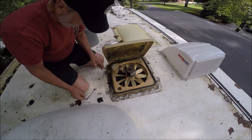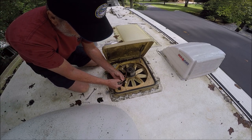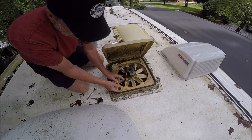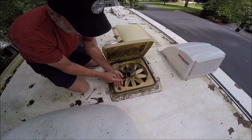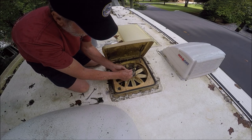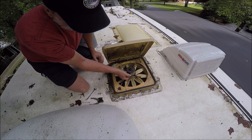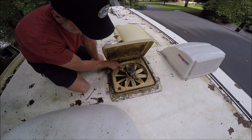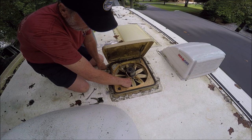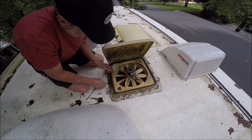Now take your cutters and cut these wires right at that point, leaving yourself enough length — maybe cut a little further back since you'll need to strip it. Pull this one out. This is the old motor, and you can give yourself as much wire as you want. Notice these little clips — they hold the wire into the arm. Pull up on them and they'll release; then pull the wires out.